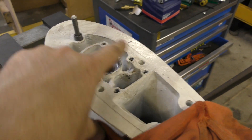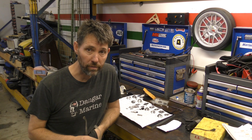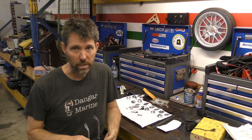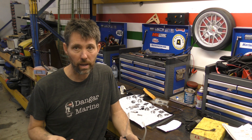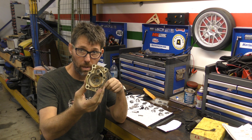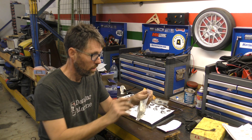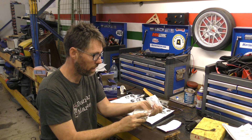The thread's all cleaned out now, so let's start putting this pump together. Once you've taken the old water pump off, the next step is to clean all the old gasket material off. We've already done that because we painted this gearbox, but if you haven't then you just need to scrape it all off. Here's our old pump housing, which is worth hanging on to for reference while you put the new one together.